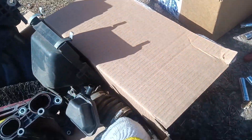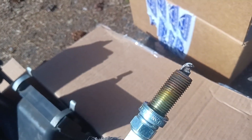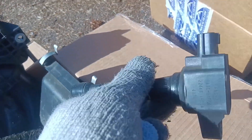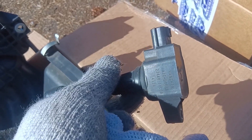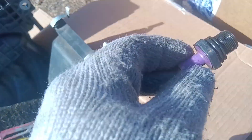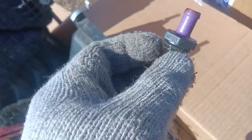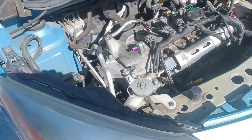Let's have a look at how these old plugs came out. As you can see, nothing extravagant — just really ready for a tune-up. It's time. I expect this car will run better right away. None of these coil packs were dead, but they've been doing 10 years worth of zapping, so time to get them out. Always love it when my new plugs are exactly what came out of it. NGK out, NGK in — same deal. There were about 12 different kinds, but the purple one with the glass fiber reinforced is what they put on it, and that's what I try to run.